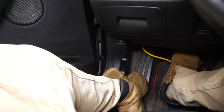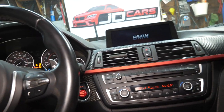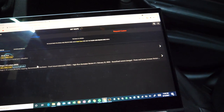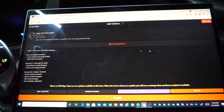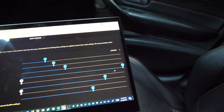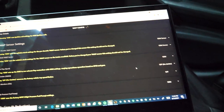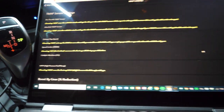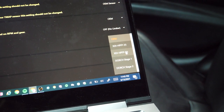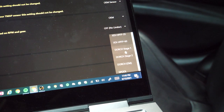Tuning time — the car is hooked up to the OBD port via ENET cable. To enable the Dorsch pump, go into your map (running Stage 2, 93-octane), go to Configure, scroll down to high-pressure fuel pump, and you'll see options for XDI and Dorsch. Select Dorsch Stage 1, then reflash.